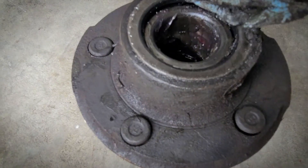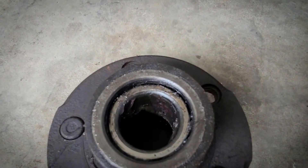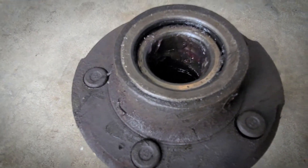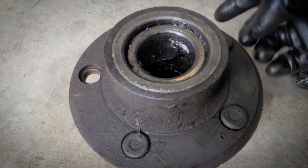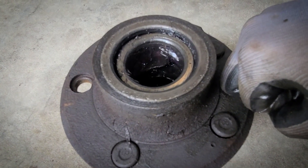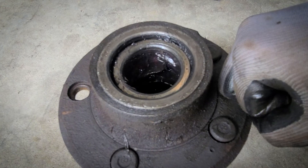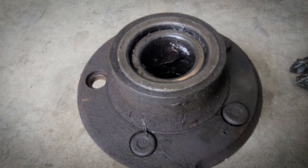We've got our seal and our bearing back here. I am going to come back and replace all the seals, replace all the bearings, replace the U-joints. But this thing's been sitting for so long that for right now I just want to get it operational — that is the prime directive. In order for it to be operational it's got to stop. In order for it to stop it's got to have brakes. In order to finish the brake lines I need to have the discs on there so I can route the front brake lines — hard stainless lines and the steel braided lines.